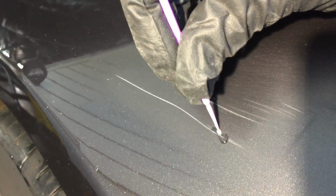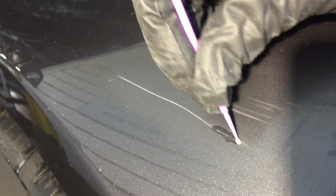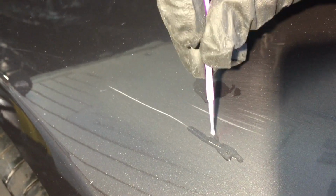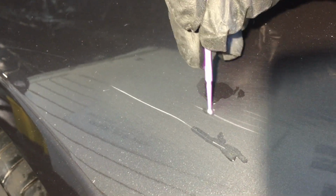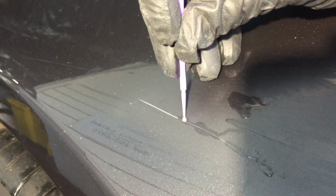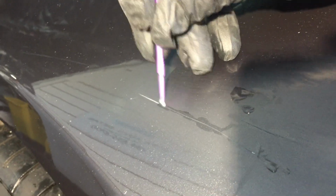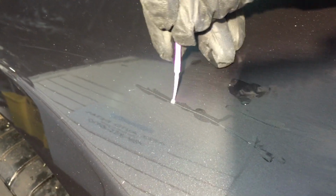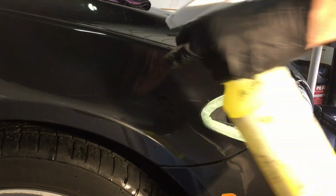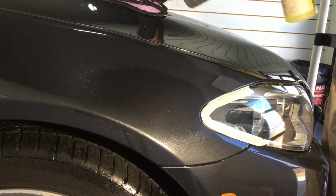The area in and around these deep scratches are clean. Now let's get inside them, in the valley of the scratch itself where those jagged edges are. Wax or hot wax from a car wash or a sealant or really anything could have gotten in there. So let's clean that out. I'll use something like this sometimes, IPA solution or maybe even paint thinner or a body solvent. Anything would work just to get it clean. And we can follow that up by cleaning the area again.